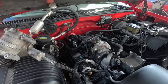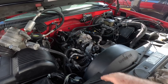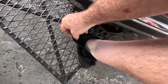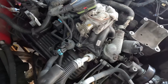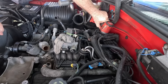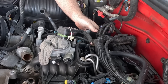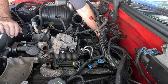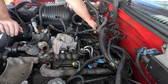I need to get back towards the distributor and stuff. Got to get that harness out of the way, the coil bracket, and a couple other things so I can get to all the bolts. Be careful not to kick this — it does a number on your ankle. It's 10mm on almost all of those little brackets and things. I haven't pulled the fuel lines off yet — I'll do that last because it's going to spill gas.